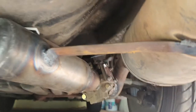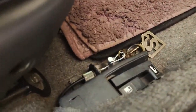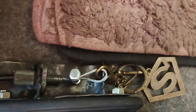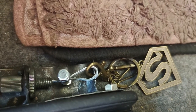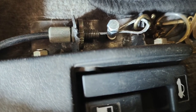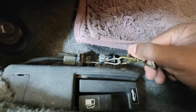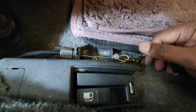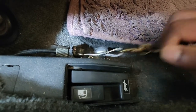So how does this operate? Let me show you. It operates with this - I have a custom on and off clamp. This is a manual system where you need to pull the trigger for the exhaust to turn on. I have used the boot opener cable, which is a long cable that can run from the back to the front. To turn it on you need to pull this and leave it - the valve is open. To close it you need to release this.